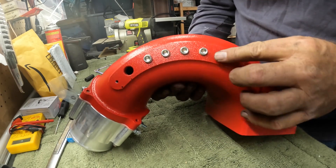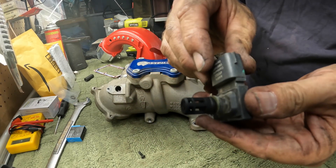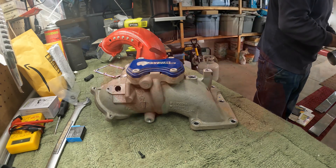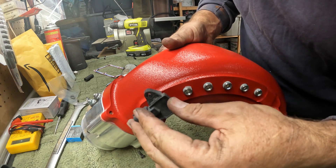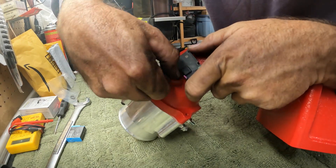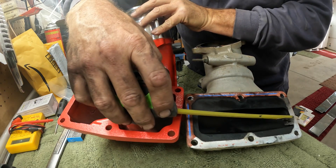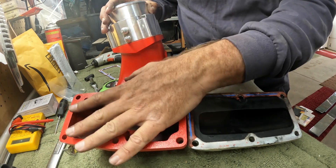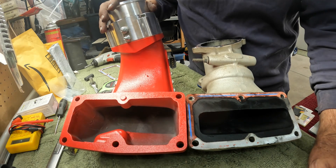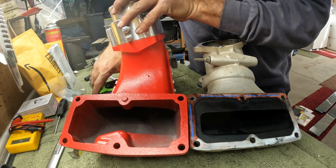Okay, that part's done. These little holes — I'm not running methanol or anything like that. Taking the mass air flow sensor off here — that is a little dirty. I have some mass air flow sensor cleaner and I'm just going to spray on it. I'm no expert but I understand a little about laminar flow, and from what I've understood from people who report after installing these, the EGT is lower at cruise speed, towing, climbing a hill, and it cools down faster.